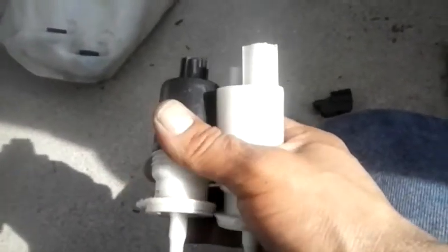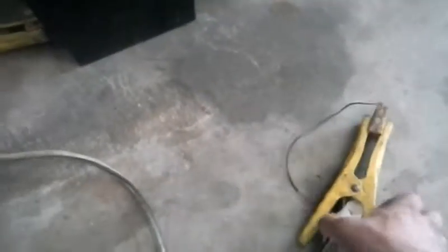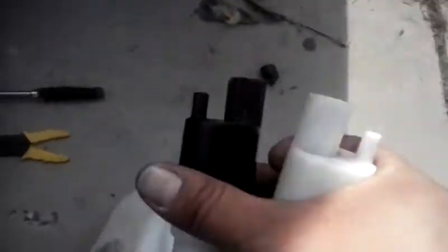The first thing I've done in diagnosing this, when somebody complains that something like this doesn't work, is check the electric motors themselves — uninstalling them and testing. I've got a row of batteries here. I get a couple wires on one end of my battery cables, a positive and a negative, hook up to a good battery, and stick it in to supply direct power to see if those motors run. And I'll tell you — the motors are good.